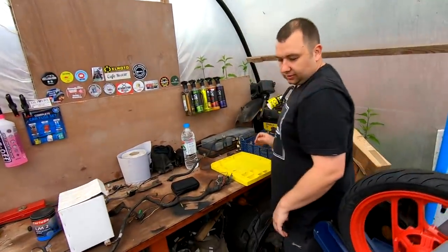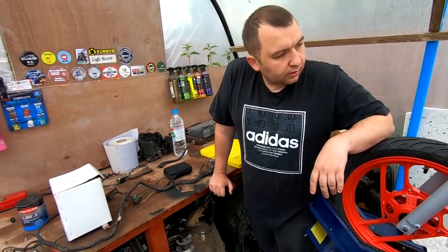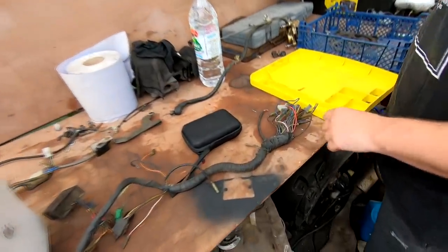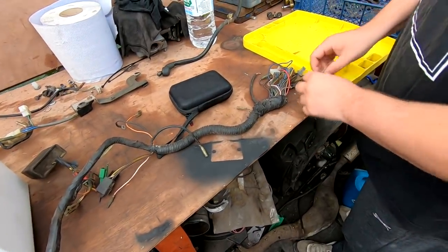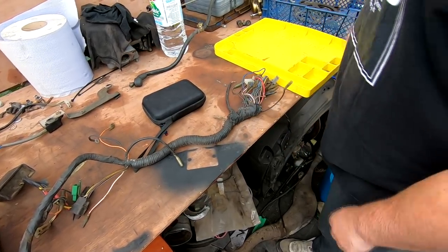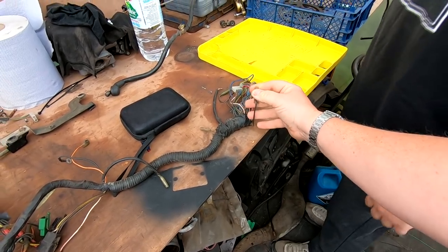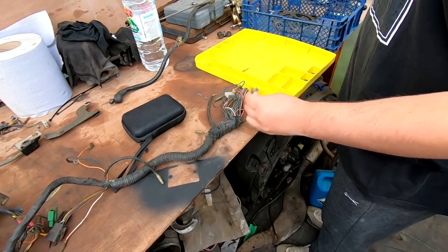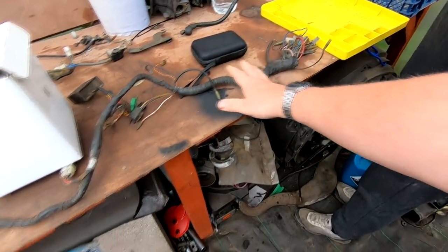I'm just going to tie it up and then I've got to do a teaser dive video, I think - is this for the weekend, Saturday? Yeah. What's this, the loom? Yeah, I'm going to re-tape, take all this off. I've put some loom tape and I want to do these ends because some of them are missing and corroded, so I'm just going to put fresh ends on them all. Are you going to buy the same type with the plastic clear? Yeah, because that will keep it original and it stops it shorting out on the frame. There's not much to a bike loom - that's the whole loom there, isn't it?